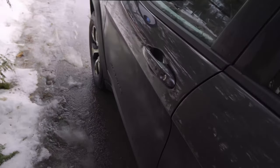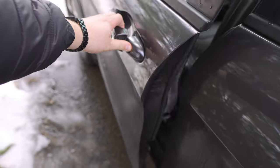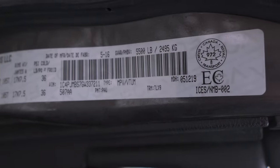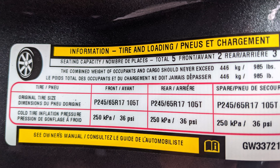Not really — because again, let's check some numbers. Similar to the truck, all the important numbers are right on the driver's side door or door jamb. The first sticker we need is the GVWR. In this case, the fully loaded capacity — empty weight plus cargo plus passengers — is 5,500 pounds for this vehicle. On the actual door jamb, our second most important number is the payload capacity. For this Jeep, it's 985 pounds.